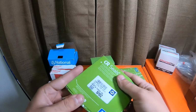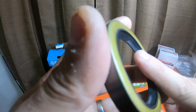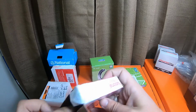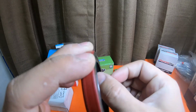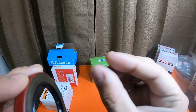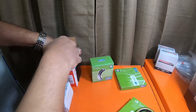And the SKs are better because they are smooth on the outer race, or the outer surface is machined. This sealing surface is also wider. This rubber seal ring is actually wider. It's about a 1/2 inch wide on this guy, where on these it's pretty much a little itty bitty baby surface. This is probably somewhere in the range of 1/8 wide or so. It's actually really small. It's only about as wide as where my fingers are, compared to this one, which is that wide. So this will seal better on the retainers, because that's exactly what one of these retainers does.